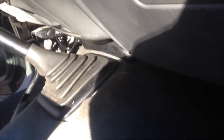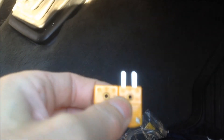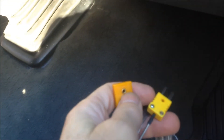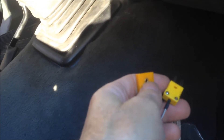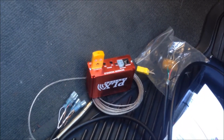So how do you do that? Well, if you look online and go on eBay, you can buy this connector. So now what I can do is plug the exhaust gas temperature sensor into that female connector there, and then run the wires through the firewall. There are some wires actually available there — you don't have to do anything special. You just connect them on one side of the firewall and through the other. I'll show you what wires I selected. Then on the other side you have the other connector, so you run this connector over to the box and you're pretty much ready to go. There's nothing really to it — you just have to wire it up.